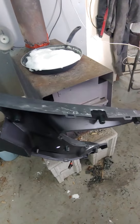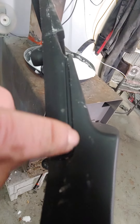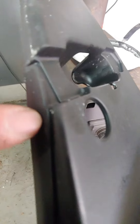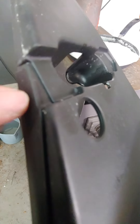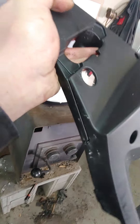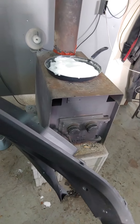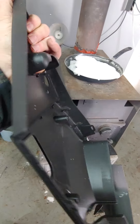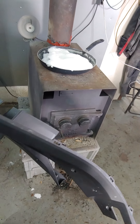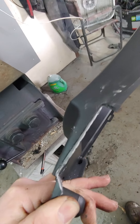Forgot to mention on the inner door panel when you're doing your trimming — up at the front, just below where the latch is, I've got another cutout. You have to cut that out. You pretty much have to take it all the way to the back and see how they want you to come up with it. I didn't go that far — I came here and did a 45-degree cut across, just to keep that little edge lip so it doesn't look all cut out. Keep it all sealed up. This part here you've got to get warm. I got lucky taking it off in the cold and it didn't break anything, but try and warm it up the best you can before you go to put it on. Unless it's summer, then you're laughing.